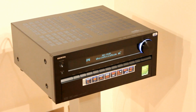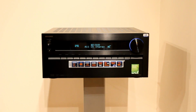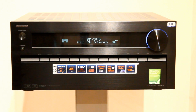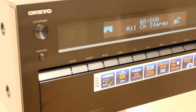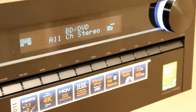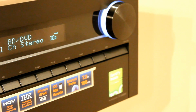It has a very high build quality, and you can see it uses the new Onkyo styling of very clean lines from the reference hi-fi range. It has the decoding for Dolby Pro Logic IIz and Audyssey DSX for the inclusion of spatial front speakers, and dual USB inputs with support for iPod digital, mass media storage, or compatibility with the UWF-1 wireless networking dongle. It's got an aluminium front panel and front flap, so you get that lovely clean design with minimalist visible controls on the front, just input selection, standby and the volume control.